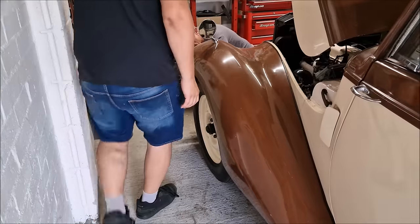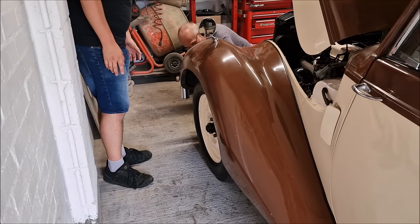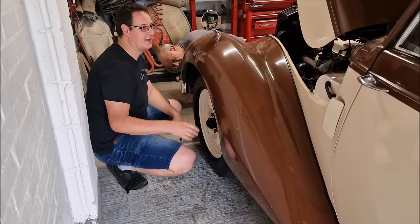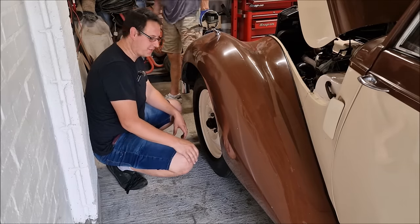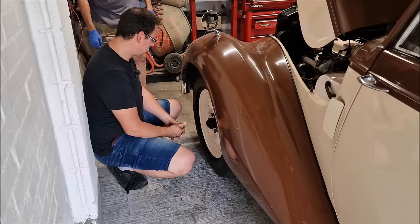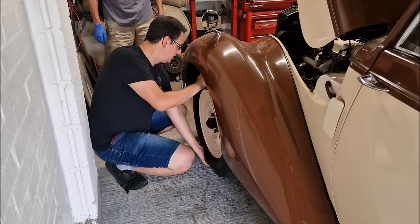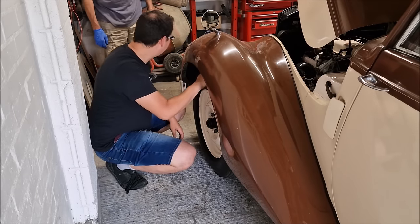So here's a question - why aren't you using the jacks that are built into the car to jack it up with? Because I've got to put the weight under the lower arm. It does have jacks built into the car - there's like holes in the floor. We've never actually tested them. I'm not going to do it - the last thing we want is to get them stuck. So we're going to grab the wheel just like this and check the play in the ball joints. There's some play in that relay in the middle - I can hear some play already. That's the top ball joint.